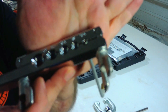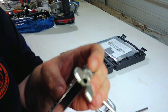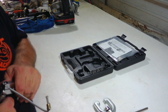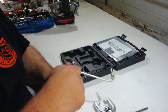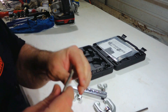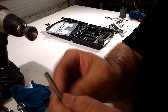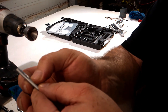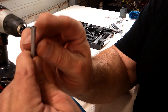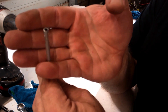As you can see, it did not create a bubble — it actually just pushed it down. So if we continue to try to run our flare down on this right now it's not going to work. If you look real close you can see where the tube slid inside the fixture — we just got a bunch of grooves and it did not start to develop a bubble at all. We still got the same look that we had previously.